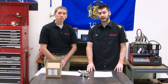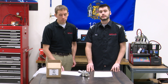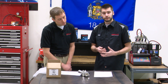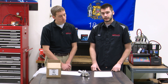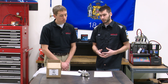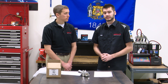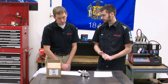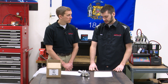To clear this adaptive memory, you need a full-function scan tool — you can't just do a simple code clear with a basic code reader. You need to get into the PCM and perform a standalone EGR adaptive reset; it is not part of the Ford keep-alive memory, it is a standalone EGR reset. If you're doing this at home and don't have a full-function scan tool, you may have to take it in afterwards to get that reset done so you have full functionality of your EGR system.